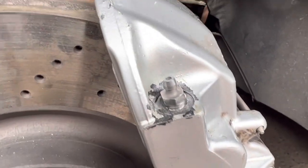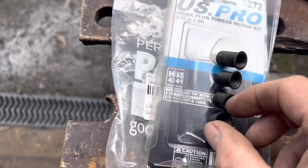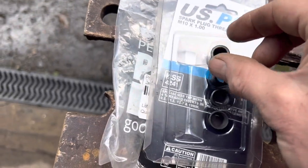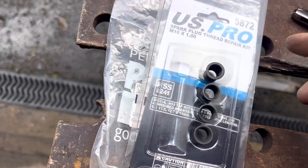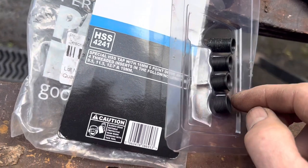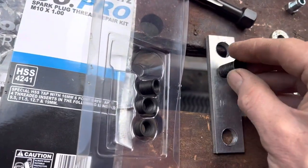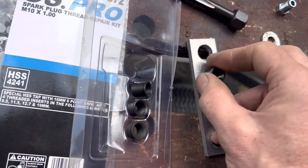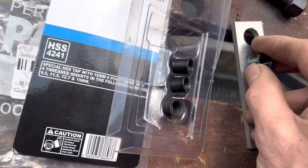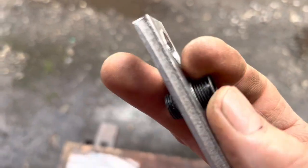You could potentially glue the helicoil in with Loctite red, but the way helicoils work — the spring expands as you screw in — that's not ideal. So we're going for plan D or E. In the context of repairing a brake bleed nipple, time-serts may work better than helicoils. These are actually a spark plug thread repair kit — 10 x 1mm — only about £5–£6 for four inserts of different lengths. Because they're not springs but much tougher, we should be able to tighten the bleed nipple down sufficiently to stop the leak.